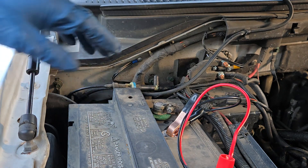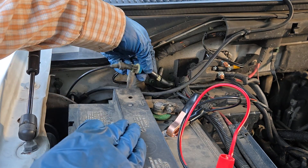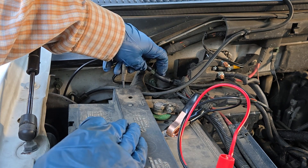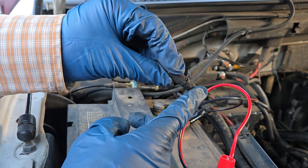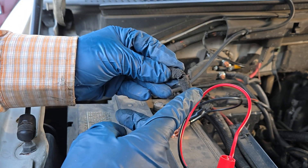Common leak point: passenger side, by the battery, close to a check valve, is this small stretch of hose. It gets brittle over time, and it has been replaced on this vehicle. Yeah, look at that.